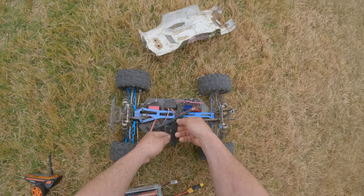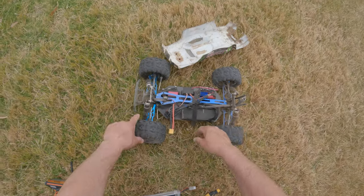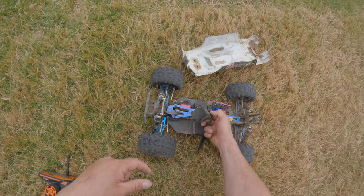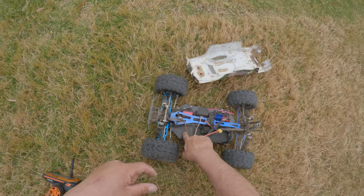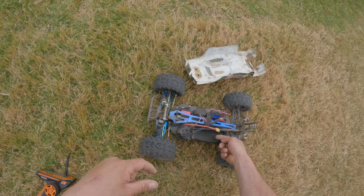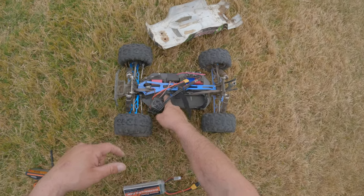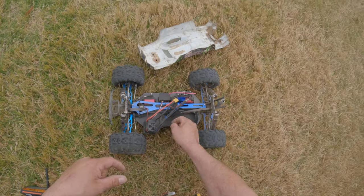Or run it on 3S - my strap broke. Everything else looks okay. The ESC's come off - it's siliconed down, normally I do silicon them down, but I reckon the battery pushed onto it. I did have a brace at the front to secure the battery in but that must have fallen off - that's probably what fell off down there somewhere.